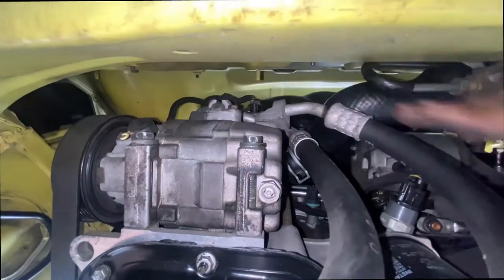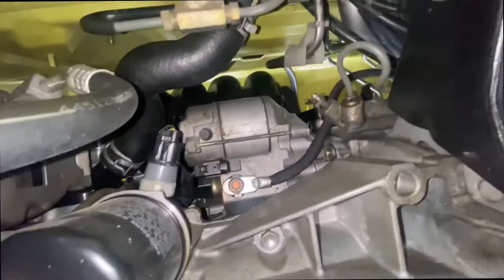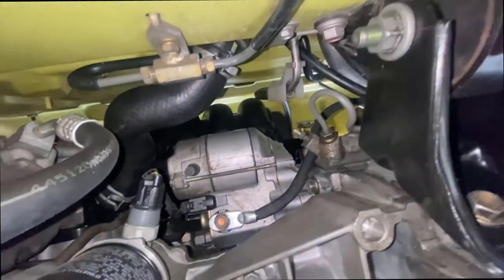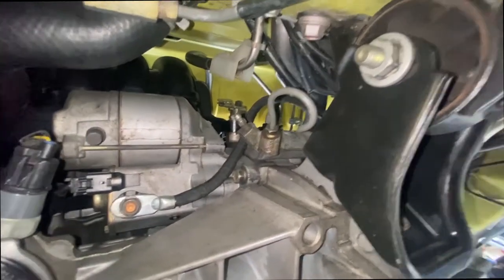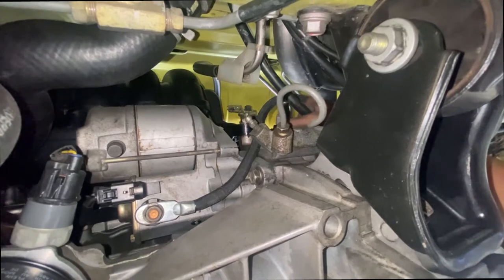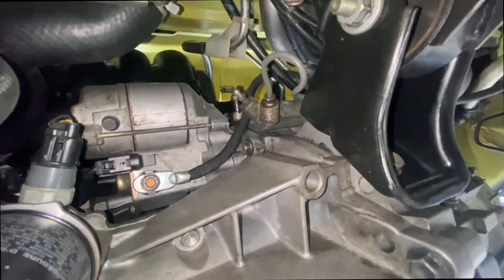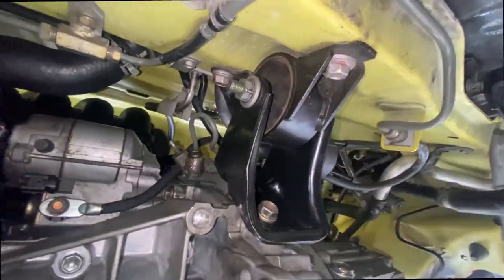Probably can't see them. Then from there, I'm gonna take off the fuel line. The fuel line should be fairly easy. It's this one right here. And then we do have to take off this slave cylinder. That's just, oh, Big Birthday, you son of a bitch. Right here. That, a couple of 12s, I think, up in top. So once that's off, I think that's all we need from back here and the motor mount. But the motor mount is the last.